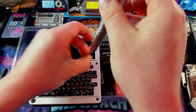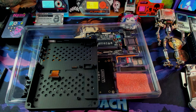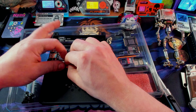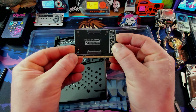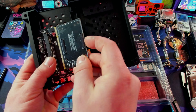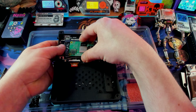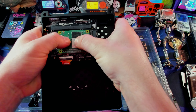Time to pop in some screws. Flip it over and install the power button, which is right here. Pop the board on, screw that down, pop the little connector on, flip that up, and snap this in. Now under here we have the Raspberry Pi CM4 adapter board, but we're not going to use that — because the CM4 and CM5 share the same interface, we don't have to worry about it at all. We go ahead and plug the CM5 in, give it a little shove — it's got little springs. Just make sure the little clips are holding in. Go ahead and pop on our CM5 and give it a click. Super scary popping this thing on, but it's in and we are on.